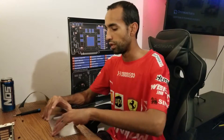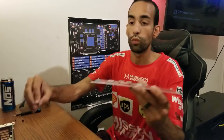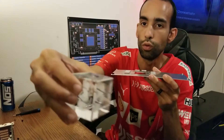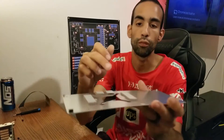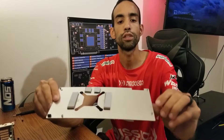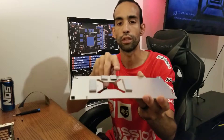Alright guys, it's a new day. Did some testing last night — memory temperatures did improve a little bit, but I noticed an issue. These little rubber stoppers that sit right here are for vibration/noise. I tried shaving them down because I noticed they were all uneven — some were 2.75, 2.6, 2.5 millimeters. When I mounted the 2.5 millimeter thermal pad — the darker one — it didn't quite adhere to the surface area of the back of the memory module, and I was still seeing a gap.